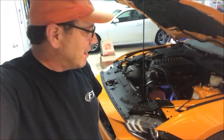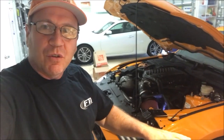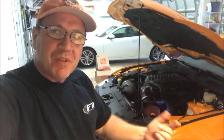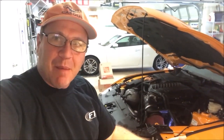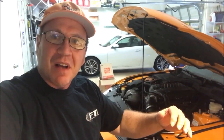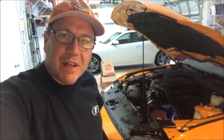All right, so I don't know if that worked. Let's take a look. Well, one thing I can say about that, much to my surprise, is that the whole airbox is sitting too low. Between the gaps coming out from underneath it, because the airbox was moved back, there's a big gap at the bottom, but there are also huge gaps at the top. So I'm going to have to raise that airbox, maybe pull it back a little bit, and see if we can get it to seal. So let's see what we can do here.